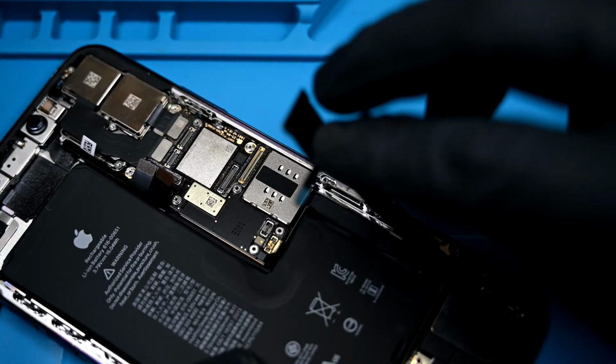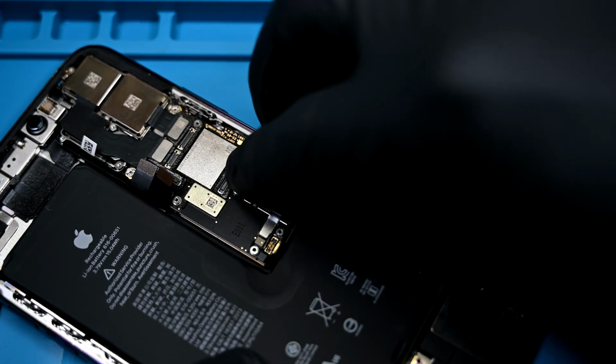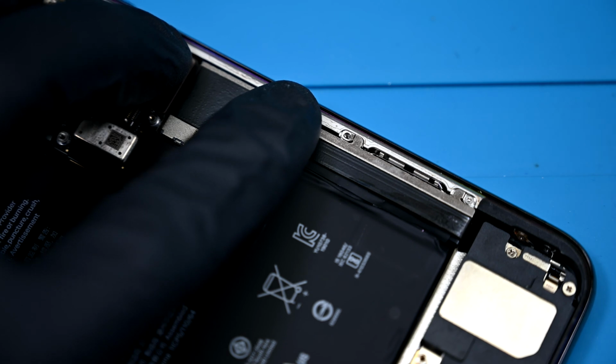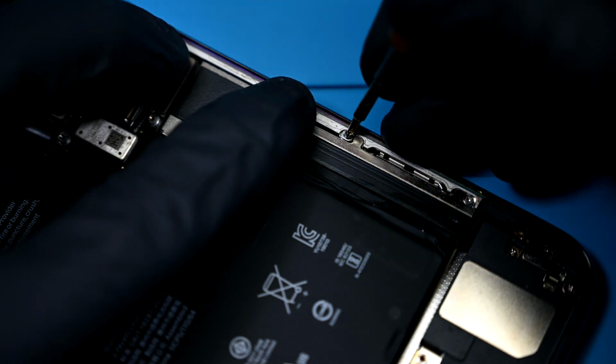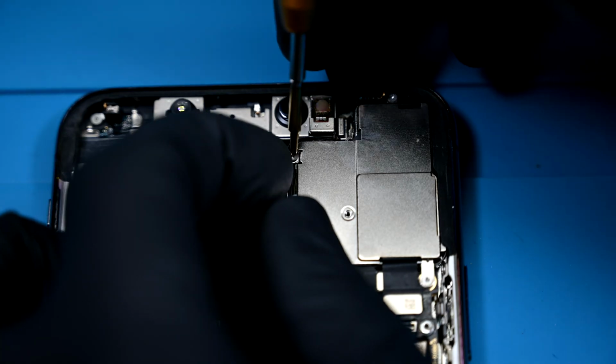The stiff charging port ribbon can be reconnected. It kind of looks like a mitten with that little thumb connector. Cute. A thin bracket keeps the ribbon held down with those 3 short tri-wings we removed earlier. You kept a screw map, right? The camera shield along with its retainer can be screwed back in place.